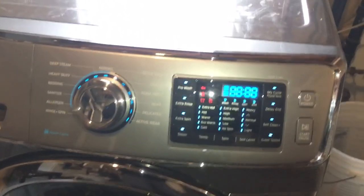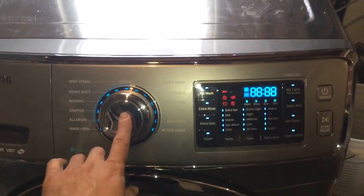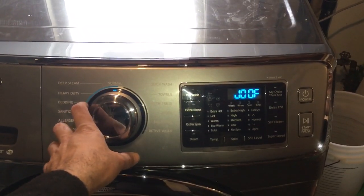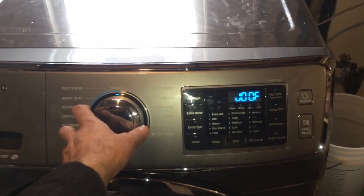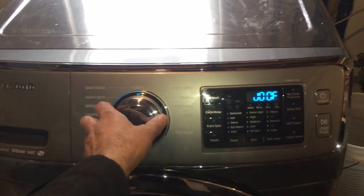After that, you can test each component with the knob. Turn it to the right — it will show you the version and then the fault code. If you don't have any fault code, slowly it's gonna go to each component and you will test them.